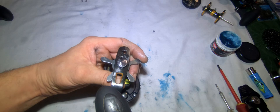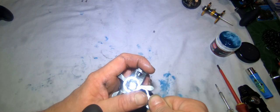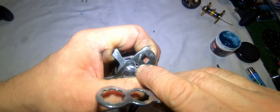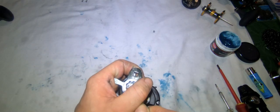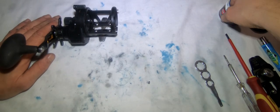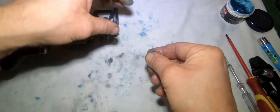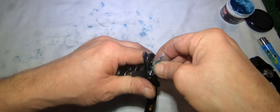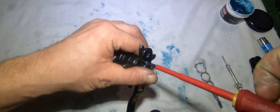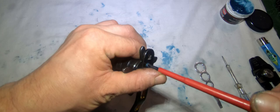When it starts to bite, take the tool and give it a tighten - again, no need to over-tighten the handle. You want that groove to line up with that hole. This tiny little screw gets the most salt erosion so get a lot of grease on it - if you get one of them stuck you have to drill it out and end up buying a new handle. Tighten that up and as soon as it bites, stop. Don't over-tighten anything at all.